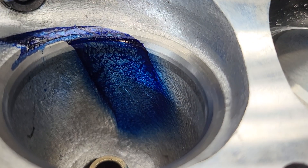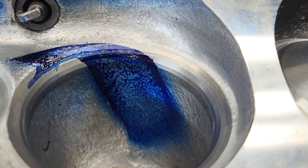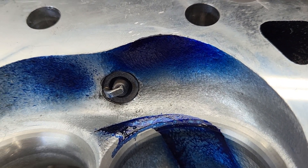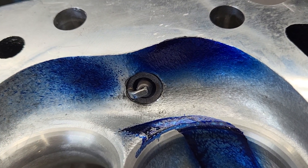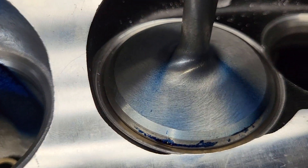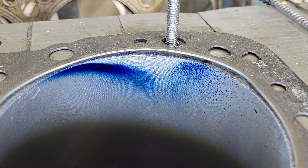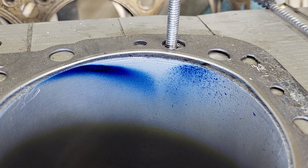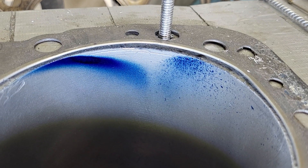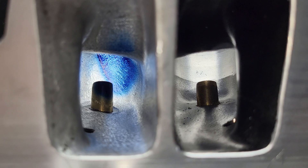The liquid flow looks pretty good. I put a rough cut on it because it is going to be a street engine. That part of the chamber looks good — we got some splatter all the way across the chamber, the valve looks good, and we got some interesting flow work inside the cylinder, which I think is quite good.